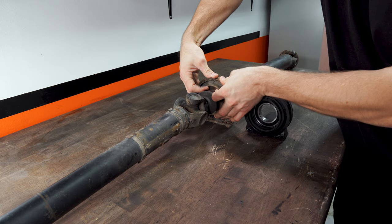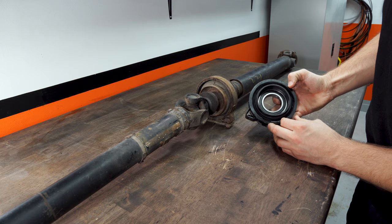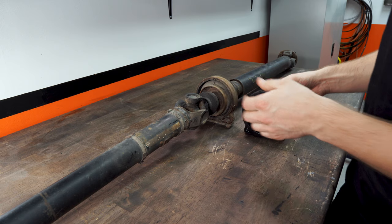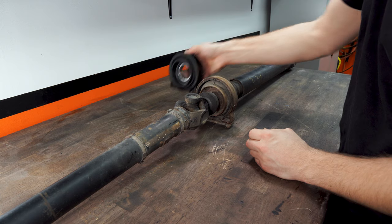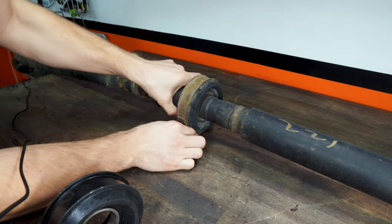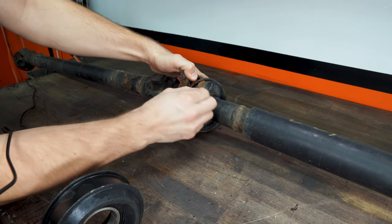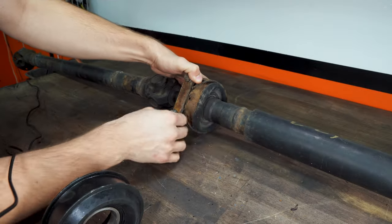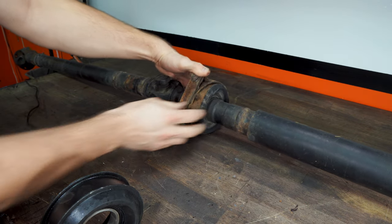You can clearly see here that the old one is completely shot. What you want to be looking at is this play up and down — you don't want this play right here. As you can see with the new one, the rubber inside is not worn out, so it's not gonna flex as much. It'll flex a little bit, of course — that's what you want, that's why you have the bushing. But you don't want it to flex excessively. Let me also show you the bottom side, because it has completely delaminated itself — you can see the cracking in the rubber. It's just gone, it's cracked. We need to get this removed.